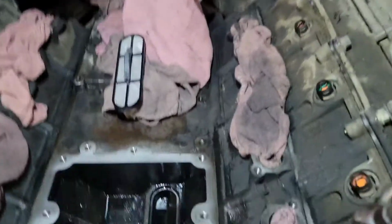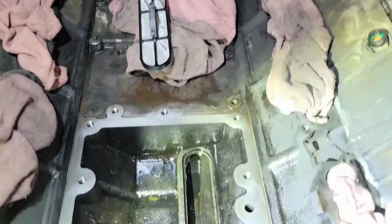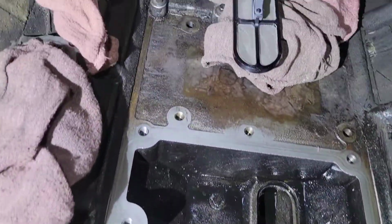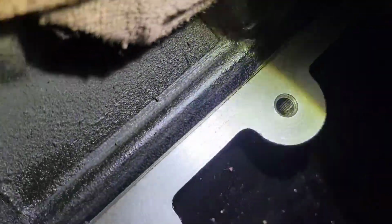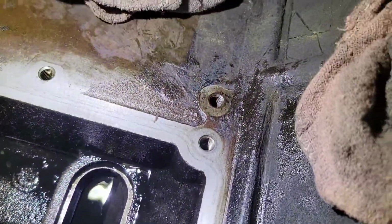All right, so now we're gonna start getting ready to assemble. We've got everything disassembled and everything clean. So now that you've got your whole area clean, make sure that you blow out every single hole for the oil cooler cover, for the oil cooler mounting, right? And also your four turbo pedestal bolts or holes. Make sure those are all blown out.